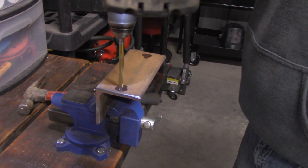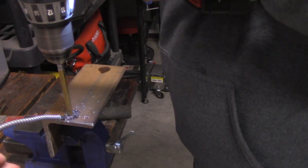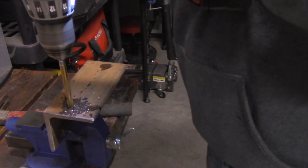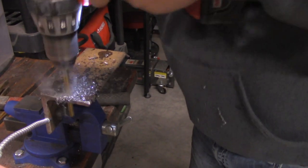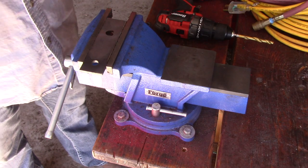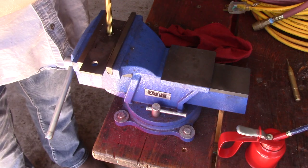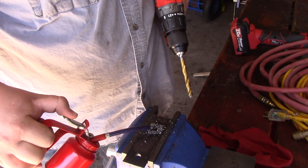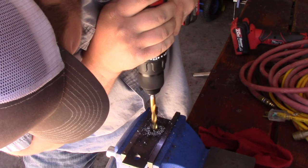But if you've been watching my channel for a long time, you've probably seen me do this multiple times. These days I just use used motor oil. Here I was using some of that Tap Magic or whatever, which does work better than used motor oil, but I like using used motor oil just because it's free. Why not just use that for things like this? Basically, you can just fill up a little oil can and make your bits last a little bit longer by lubricating metal that you're drilling into.